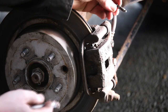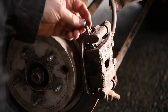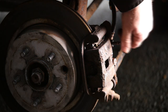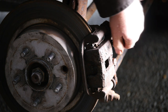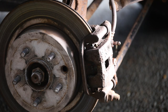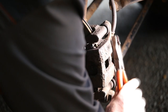So the odds are in our favour — we've gone past 50%. I'm just putting a bit of copper ease on there. Like I said I'm not sure whether you should use that — you probably shouldn't on braking systems, but for the moment I'm just going to use it. I am going to remove these bleed nipples and put new ones in. We've definitely got a drip there, so we're just going to pinch it and snug it up tight.